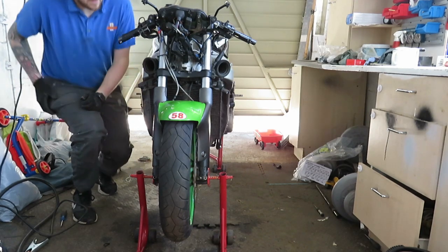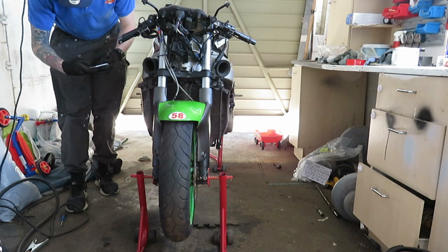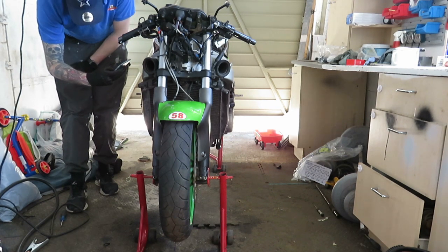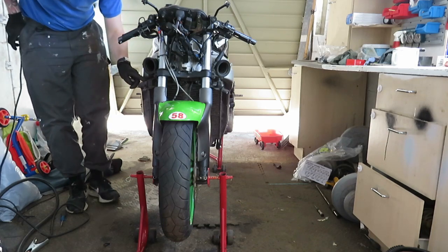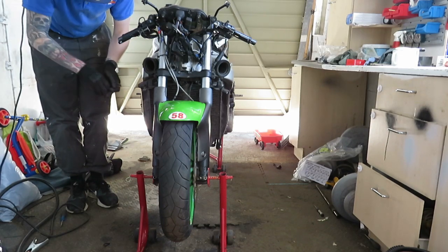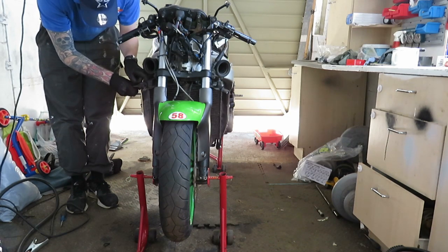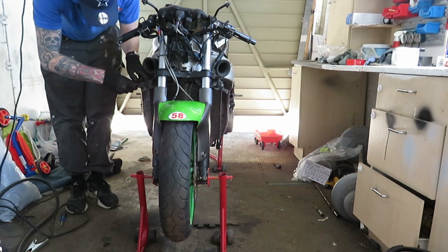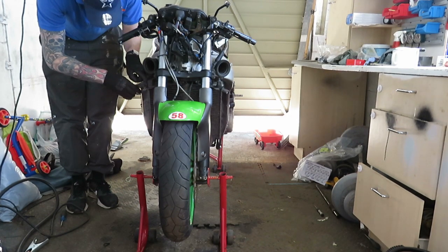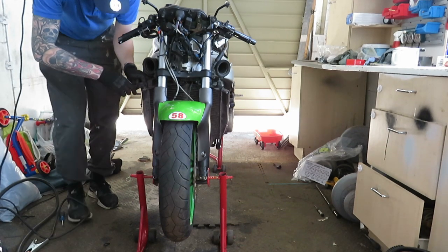In fact, I'm going to take a picture of that first, because you can mix them up easily. What I mean here is the spill off hose, the overflow hose rather, and the hose to the pump. If you mix them up, you're in a world of trouble, aren't you? Won't bleed up properly or run properly. Or cool properly. Come on.